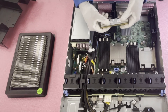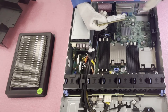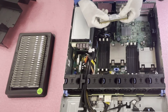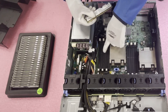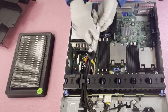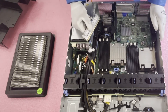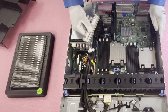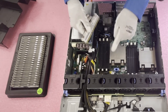For instance, if you were loading a DDR4 module into this machine it just physically would not fit. If you grabbed an old DDR2 module it physically would not fit either. It's also important because you need to make sure you line the notch up with the socket on the motherboard — if you put it in the wrong way you could damage the lead or even the socket itself. Damaging the socket could mean replacing the motherboard, which is expensive and entirely avoidable.